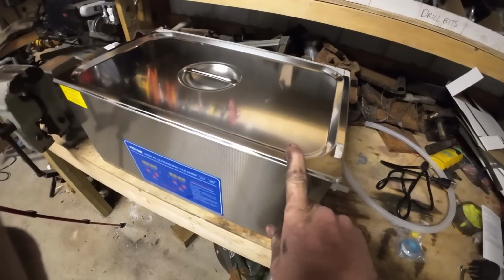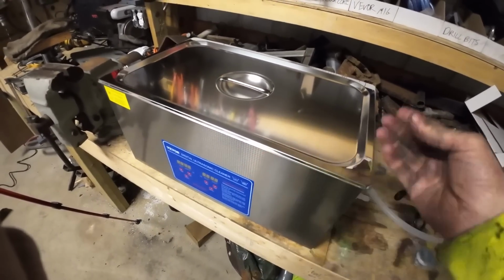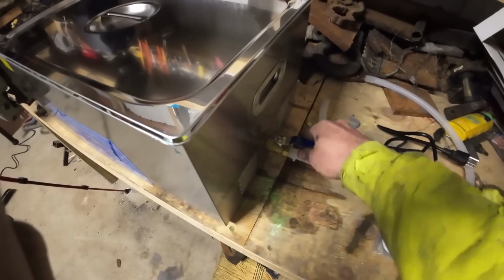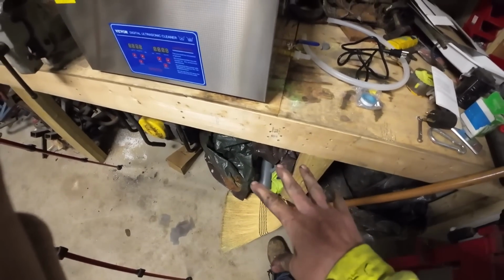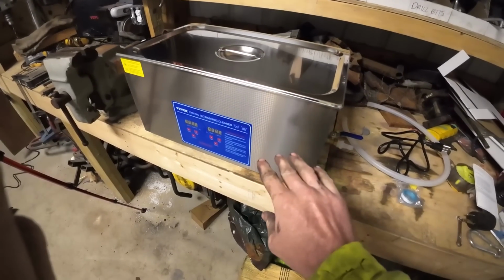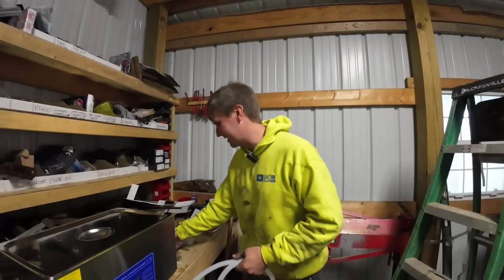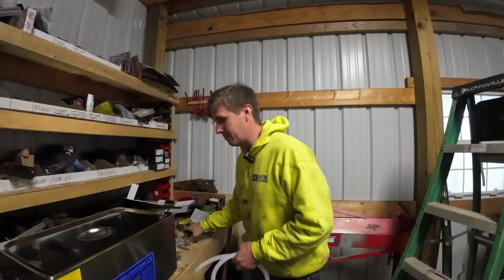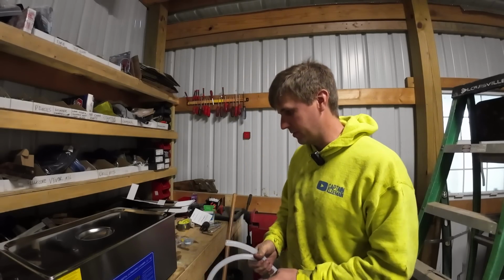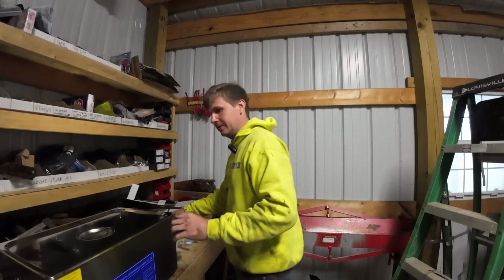I was thinking about going back and forth between degreaser and evaporust. Like we could do a round of the degreaser to get all the grease and stuff off, drain that, run it through a filter into a bucket maybe. Then we could do evaporust and try to take all the surface rust off that way. I'm going off what I've seen some creative people on YouTube and the internet do. I'm hoping to kind of match those setups because it seems to work really well. The fancy people have multiple ones. You got different kinds of chemicals in each one.